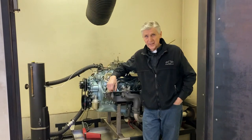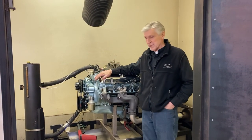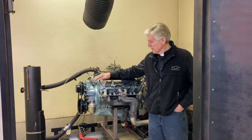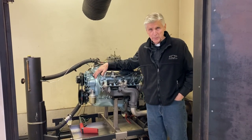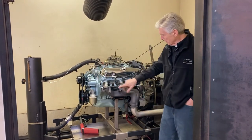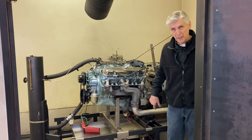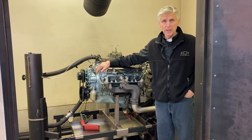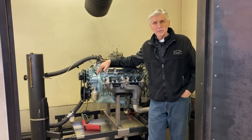Welcome back to Gold's Grudge. We're back at Darrell Waters Dyno Service in Springfield, Ontario. Just about a week ago we made a video about this same engine — you've seen it before, because we dynoed this engine previously and were disappointed in the power. It put out 355 horsepower on manifolds and about 375 with headers. Right now we're back to the stock original OEM-style manifolds, which is how it will run in the car. We plan to install headers after this session to see what they add.